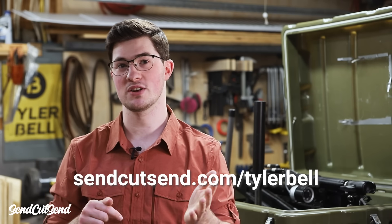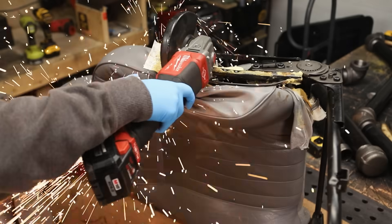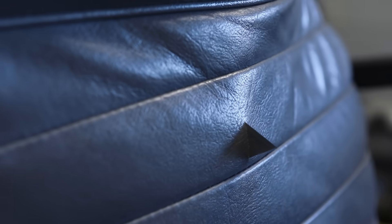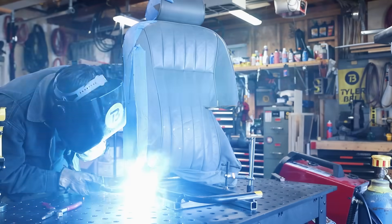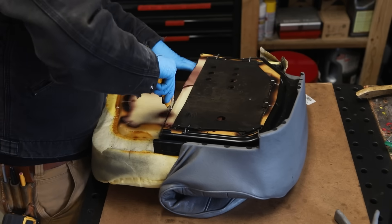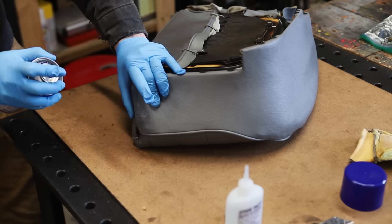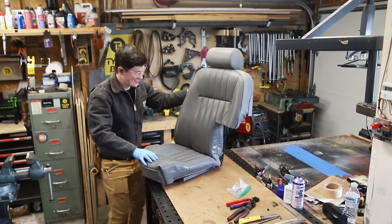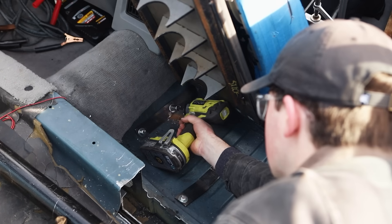So if you want to step up the way you build things, use the link below for your next project. Like I mentioned before, the seat had to be moved inboard so it could clear the roof, so I notched the frame of the chair to fit around the center console. I wanted the seat to look totally incognito and look like a normal car, but this is one compromise I had to make. Once I had the original seat modified, I welded its factory frame to my new frame, and then came the upholstery work to make it look like nothing happened.